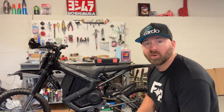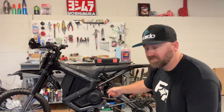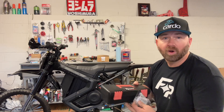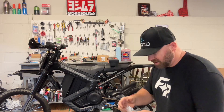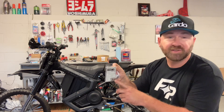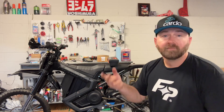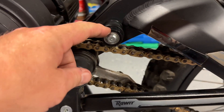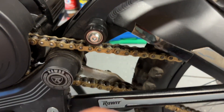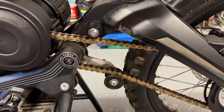It is on the stock chain guide roller system right here. This plastic guide that you will always hear your chain hitting as your chain is spinning — it just makes this obnoxious noise. I'm going to show you how to make a very quiet guide out of what comes in the RAR Mantis toolkit as well as some skateboard bearing washers and 5/16ths spacers. This literally shouldn't cost you $10 and you will thank me later.